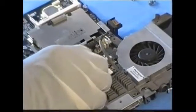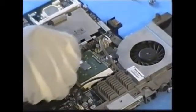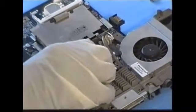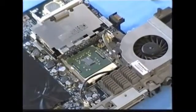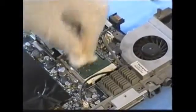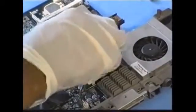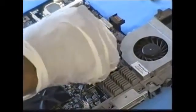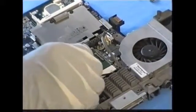This doesn't take a long time, just need to be patient and don't mess up. Keep scrubbing, get it off — sometimes it wants to be a little stubborn. Okay, cotton ball, fill up the rest. Turn around the top of the processor here, spray some more alcohol on it.